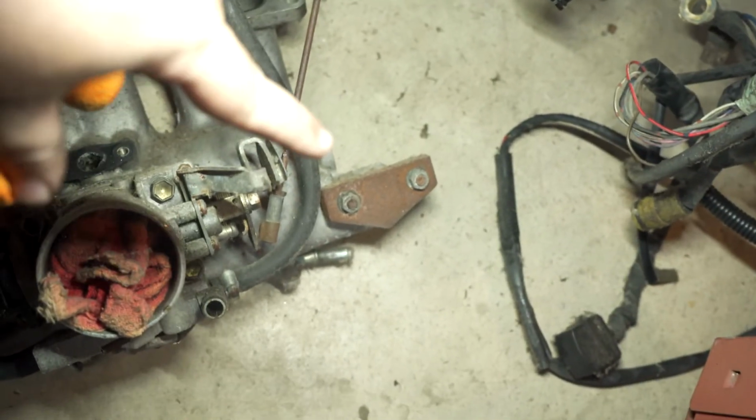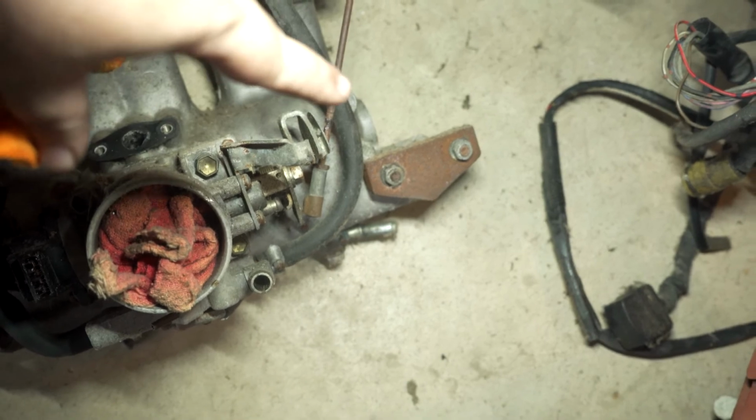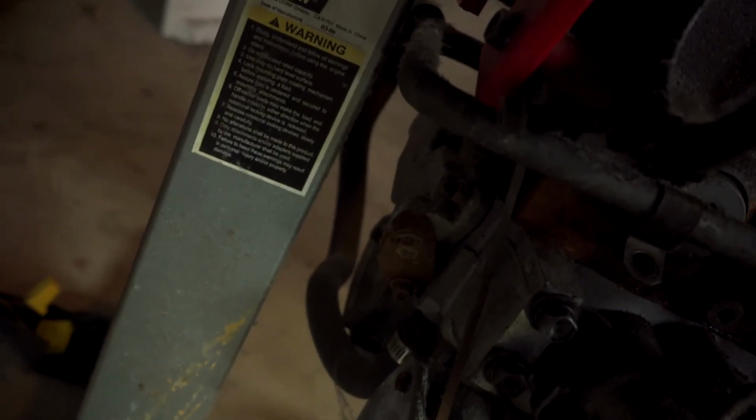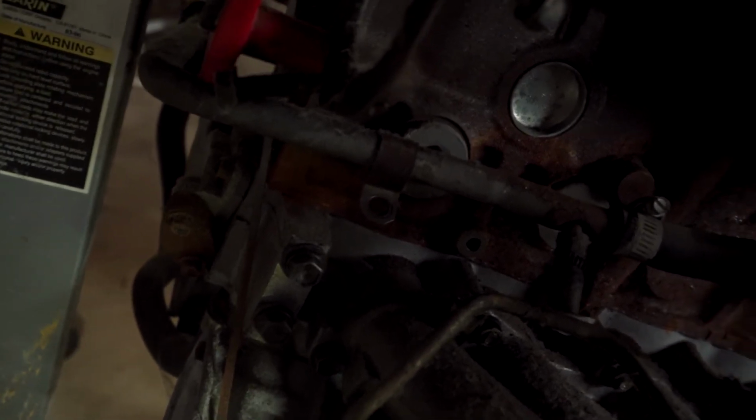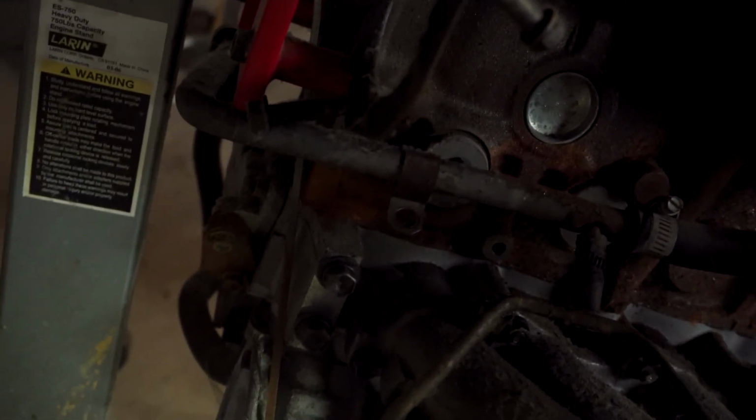I wanted to point out something that I discovered. This is the EGR block-off plate I had made for the manifold, and here's the one for the back of the motor. Come to find out, I have one of these made for the 7M too, but from reading at Drift Motion, by doing this, the exhaust gases still run through the back of the head, causing the back of the head to heat up and causing blown head gaskets. One of the reasons M-series motors, mostly the 7M, are known for blowing head gaskets is this, other than the heads needing to be retorqued. But it has a lot to do with this emission stuff that was added to American motors.